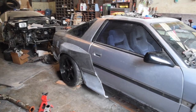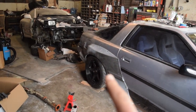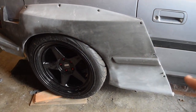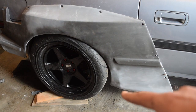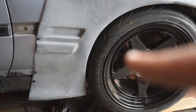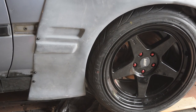The Supra is on the ground now but I made a couple changes that are going to affect the way that we trim. I adjusted the spacers in the back and in the front — the front now doesn't have any spacers, and the rear spacers are an inch shorter. This means we have less to trim on the back and on the front of the car. So the next step is to get this trimmed out — we're just going to take a little bit off the front here, curve it out because the tire would still hit right there in the middle, then do pretty much the same thing in the rear.